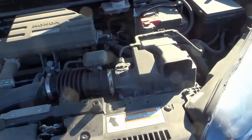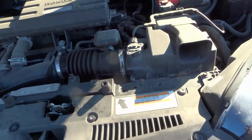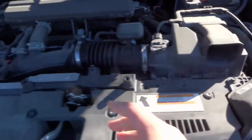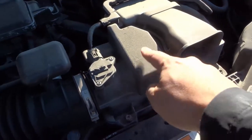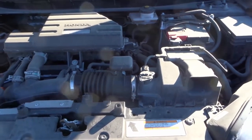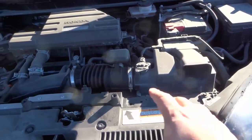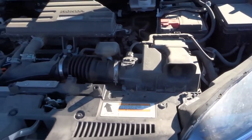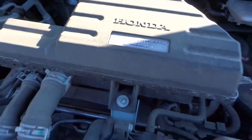Number seven is the air filter. The engine needs air to operate — it needs to suck in air. You'll find either an opening or a hose that connects to the engine, and there's an air filter box. You can usually take it out with a couple of screws or latches, and inside is the actual air filter. In older cars it's just a box with a pipe, but this is a more modern car with a 1.8 liter turbo, so there's a bit more going on.